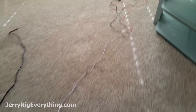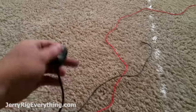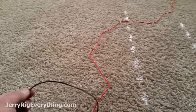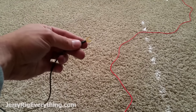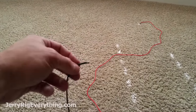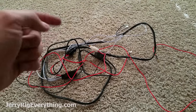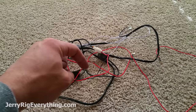The other leg that comes away from the relay is this white leg and it's for the switch. The switch itself you click it on and click it off. The black wire is just going to go to a ground — basically any screw that's attached to the frame, just stick it in there and screw it down. Then the red one needs to go to the battery itself. Without a good ground and without that being on the battery, the switch isn't going to work and the whole wiring harness isn't going to work. Everything for this project — this wiring harness, the lights, everything — you'll be able to find in the video description below.